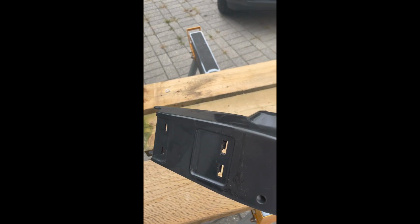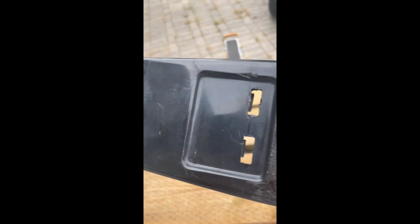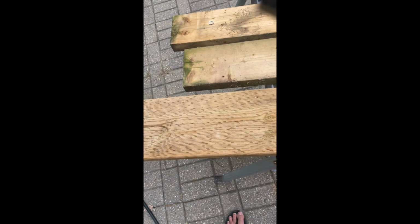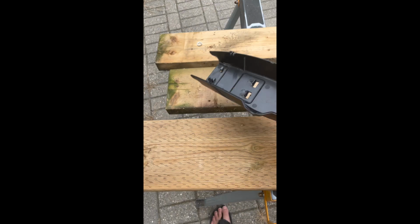So there we go. The end of welding day. I had some tabs on this that were broken off. I welded them back on. In that particular thing, the inside idler system that I was just welding clips into those tabs, both those tabs that you can see through there are what hold it on, and both were broke. So I added some reinforcement in the back and made them rigid, and then one of the outside clips that hold the two pieces together around the idler head was a little loose, so I put that on, and I threw a little piece of that screen on there to try and give it a little more rigidity.